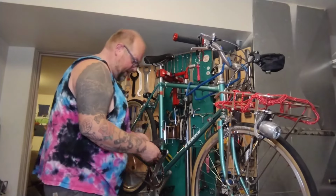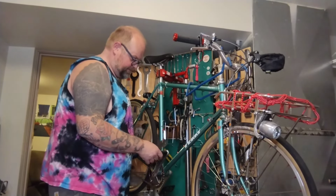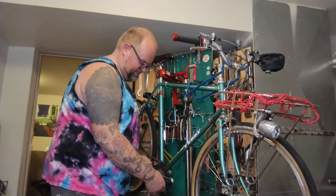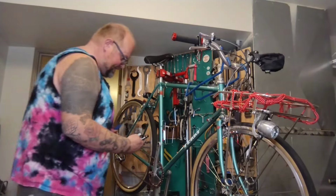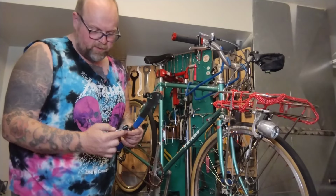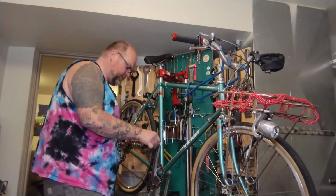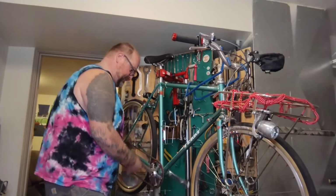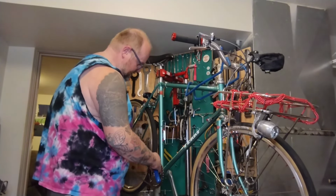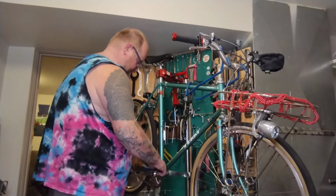I think with sliding seat posts, the trick is to use carbon paste instead of grease. We'll see. Goodbye, plastic pedals that actually flex a lot. Cheap and insignificant, totally unimportant, and just wonderful. I pre-grease these. These also have a full round lip all the way around, so they don't need a pedal washer. They're not going to chew up my cranks. I'm not sure if I'm actually in love with these pedals, but they look way cooler than anything else that I could find.